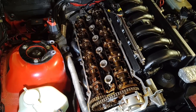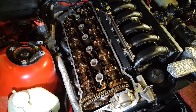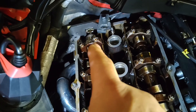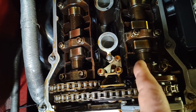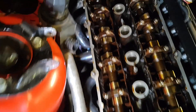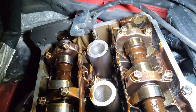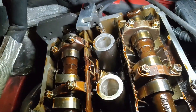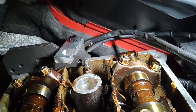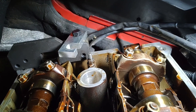Okay, took the valve cover off — didn't film that, it's not really a struggle, just annoying. I found OT and found home with the exhaust cam locking block. That's straight. The two front cylinder one lobes are facing each other, so this is the correct position to adjust the timing. You can see here — the lighting and camera aren't great — but the intake cam is slightly tilted to the left, which means it's slightly retarded from straight up.